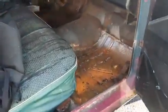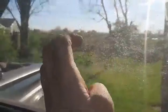The only bad thing about that guy welding floor pans in, he did a pretty good job. We'd have some spots to fill in and finish it. But he welded with all the glass in here, and you have this texture. This is actually steel from the sparks, and it's embedded in the glass. So he kind of screwed up there. It's not terrible back here. Some of it can be cleaned up. Not the biggest problem, but if we can find more glass, which we probably can, we'll do that.